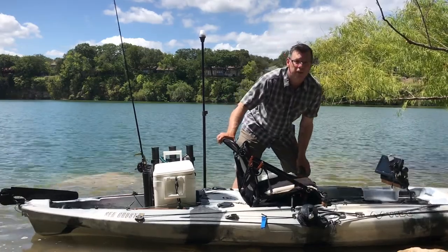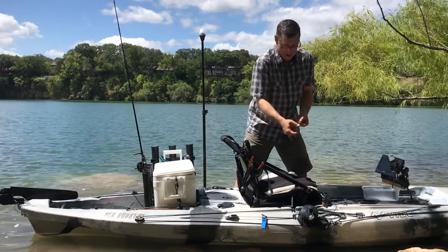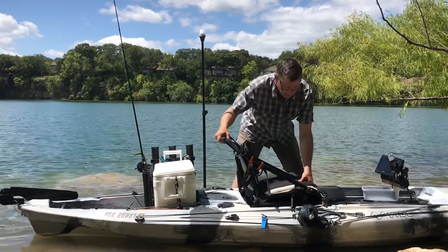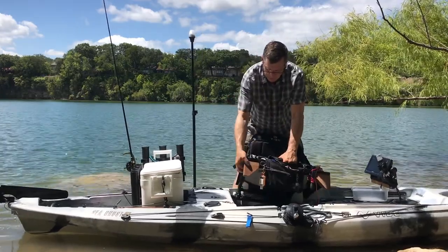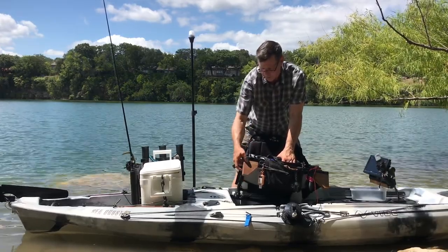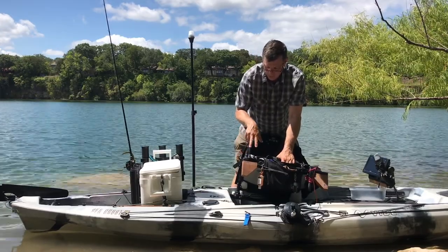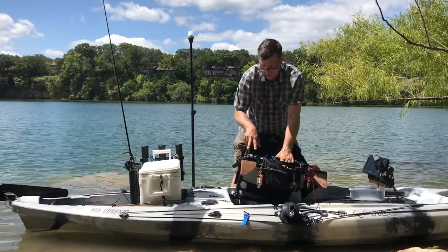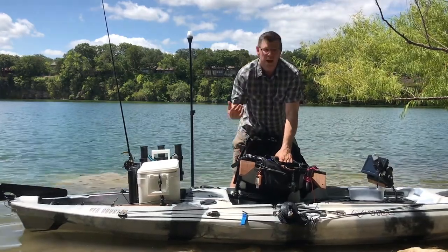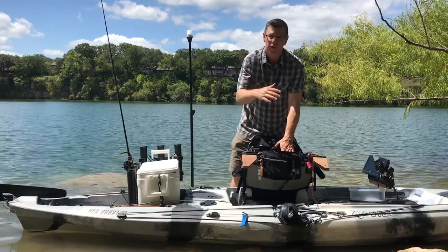On the seat, this was a 2016 model. The front of the seat — I know there have been some complaints because the seat height was a little bit low. Originally I would stick a piece of PVC pipe in here in the front to raise it up a little bit. But what I went ahead and did eventually is I built these blocks — they're four inches tall and all they are is some Ipe wood, which is strong wood. There's not really any flex on them forward to back, it's just all compression. All I do to hold them in is drill two holes through this front bar and run a two-and-a-half-inch deck screw — two of them in there. It's held up for the past seven or eight months. It works great for my body mechanics — gets me up a little bit higher, and it works in both the low and the high seating position as well.